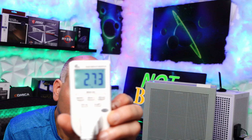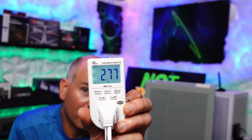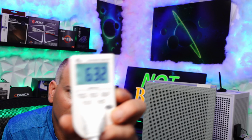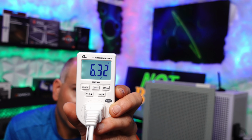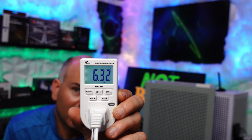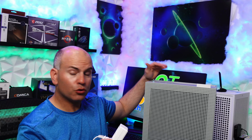What I want to know is the power usage. So, watts: 2.74 watts, but with our power factor being so bad, it's going to be closer to 5-6 watts on low, which is actually very efficient. So low, that's our VA. Because our power factor is bad, you can use more power than it says, but yeah, that's pretty low power usage despite being on low anyways. So despite our low power factor, it's energy efficient. This means it's probably using a good motor in it to actually get such a low power usage.